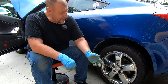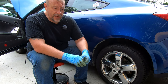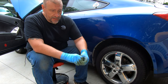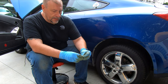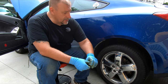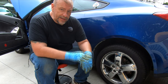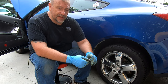That's all there is to it — it's more complicated because I had to do that caliper, but if that caliper doesn't turn back in, you know that caliper is no good. It's all rusted out, you need a new caliper — don't even mess with it. Don't try to repair it because I don't think you're going to be able to do it. Just get yourself a new caliper. They're not cheap, but in the end it's about doing the job properly and making sure it leaves here with the proper working parts. Don't forget — pump your brake up, make sure you've got a good brake pedal before you take off. You all take care, God bless, catch you on the next one.